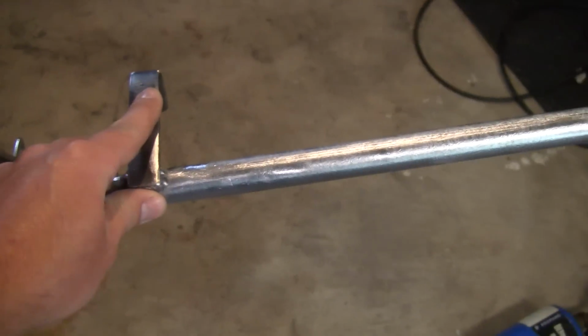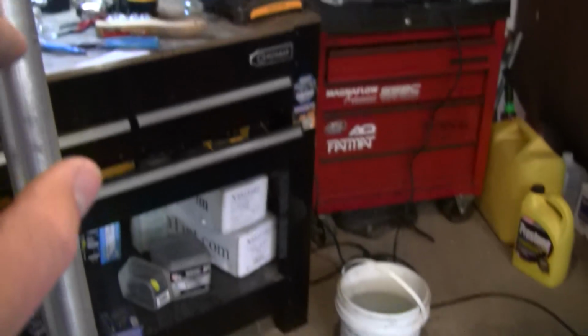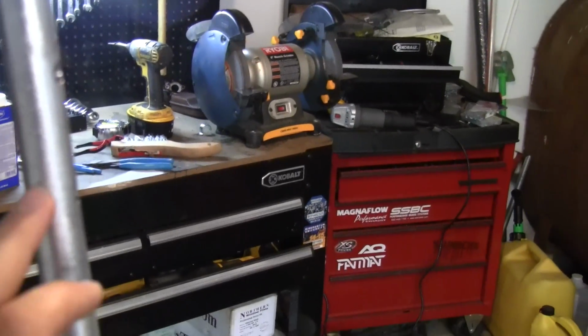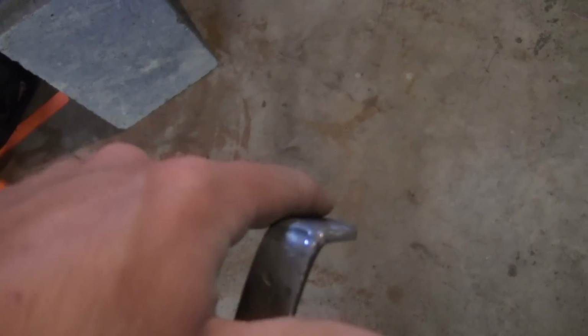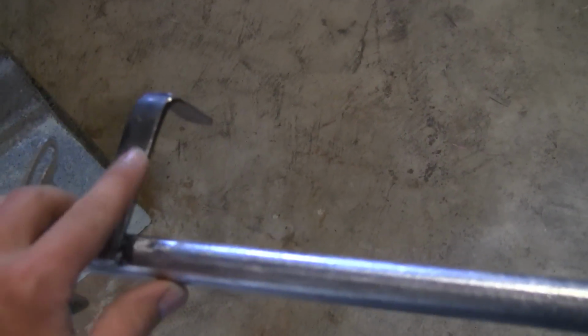These are my feet, so these bolts will just hold it in place up there, and then on these feet I'm going to put some of that Plasti Dip stuff, I don't know how well that'll hold up, but I ground these smooth so there's no sharp edges or anything. It's really smooth, so that's going to carry most of the weight of the light bar and the rack and everything, and that'll keep it from bouncing.